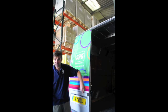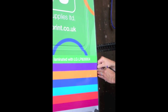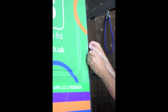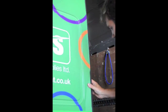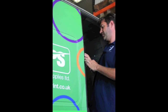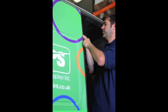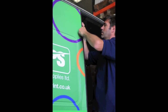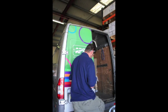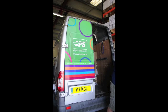Finally, trim off the excess areas of vinyl not required, such as around edges of bodywork, on hinges and between doors. The vinyl edges need to be tucked tidily away behind bodywork trim areas — so when trimming off these areas, leave an excess of a couple of millimetres to wrap around the edges of the doors. Work the vinyl into these edges to both hide and help protect the edges of the vinyl. Reattach any furniture and fixings that you may have removed from the vehicle, such as badges, rubber edging and window trims. Finally, look all over the vinyl very carefully for any trapped air bubbles you may have missed and check that all vinyl and edges are properly adhered to the surface. Any small air bubbles can be removed with a small puncture at the edge of the bubble — then heat it a little and push the air out.